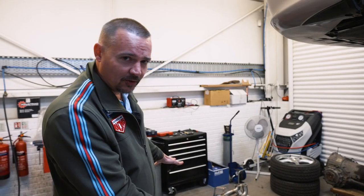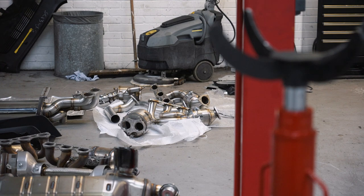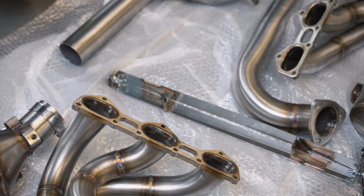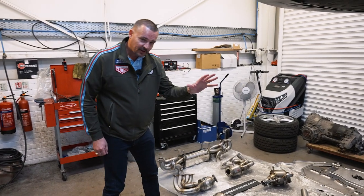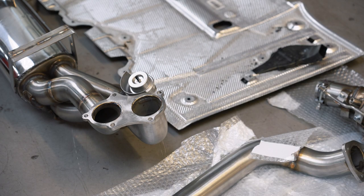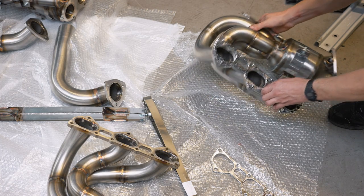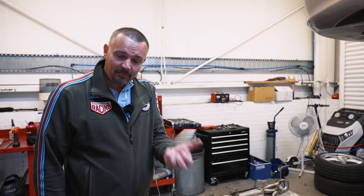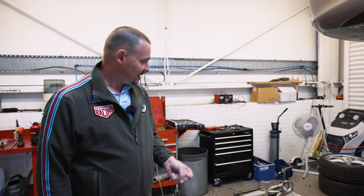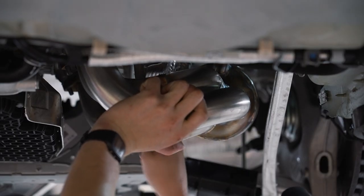Okay, so on the floor behind me here we have the various bits and components of the Car Graphic exhaust system which is going on the Spyder. The first thing that's going on is the manifolds, and then here we have the revised OPFs — so they're free flowing, no engine warning light, fully EU compliant. Then we've got the joining pipes and then we go into the rear silencer, the race competition silencer. This is fully controllable with a little thing I'll have in my pocket, so you can have it totally off, you can have it at factory setting, or you can have the valves open right through the rev band. That bit will be very very exciting to listen to later.